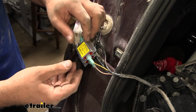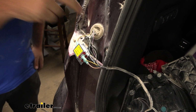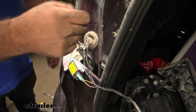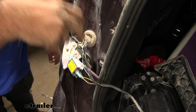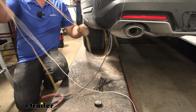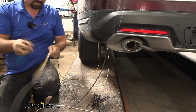And then at this point, we need to pull up our wires that we ran back here. It can get a little bit tricky sometimes to pull them up. We use an airline tube to fish wire this. If you need to, you can use a string with a nut and drop that down like a plumb bob, tape those wires and pull it up. So we do have quite a bit of extra wire. I'm going to make sure that I have more than enough to pull up and then cut off the excess.